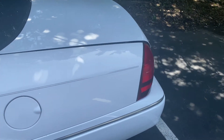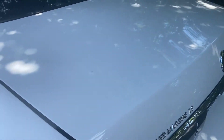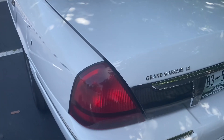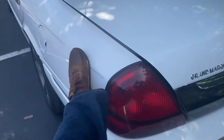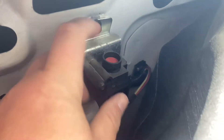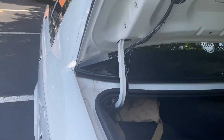Something not helpful at all — unless you want to play really mean pranks on somebody that owns one of these cars — is that these cars have a fuel pump inertia switch. It basically shuts off the fuel pump if there's a crash or if the car rolls. What you can do is give these cars a real good solid kick in the side and it will shut off the fuel pump. That's probably not a good thing to tell people. But if you ever have a fuel pump problem, check to see if this little switch back here has tripped. Sometimes people will open their door into your car and trip the switch.